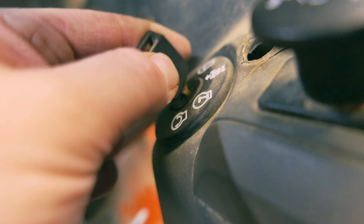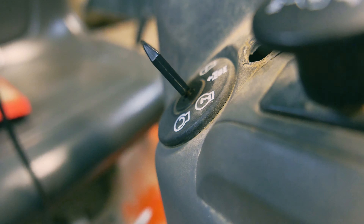Here's a different video that you guys are probably not used to seeing from me. I am working on my wife's grandma's lawnmower. The issue is that the solenoid went out, and I don't have the original solenoid. The solenoid that came on it is no longer working, and on top of that, the key switch that starts the mower is no longer making contact. I have to fix this with a new universal solenoid, rewire a bunch of stuff including the ground cable to the chassis, and I'm going to get started soldering.